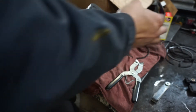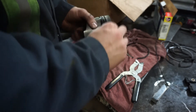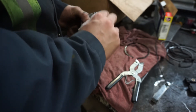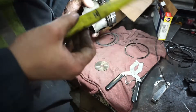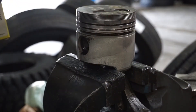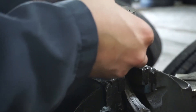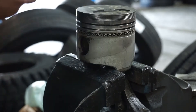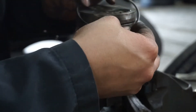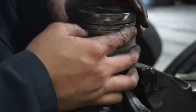Now that clearances are checked we're moving on to assembly. I'm removing the old rings off the piston — the old oil ring just breaks off because it's so old and brittle, probably the original. I have a tool here that really helps clean inside the grooves where the rings sit. On this piston specifically the rings are tapered, so you really want to make sure they're nice and clean so the piston ring doesn't pinch inside the groove causing a dead hole. Then I install the oil ring first — you want those two tabs pointing up toward the wrist pin.